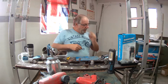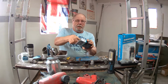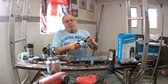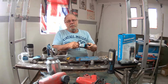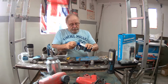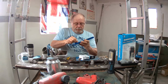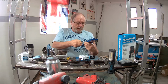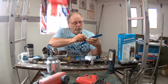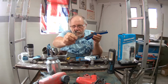Right, where are we? Oh yes. Here we have some spot weld kit. When you take panels out, you drill the spot welds. A lot of people just grind them down and that makes a whole mess. These are spot weld cutters. They should be in there, but you get the idea. They fit in your drill and they're very sharp.